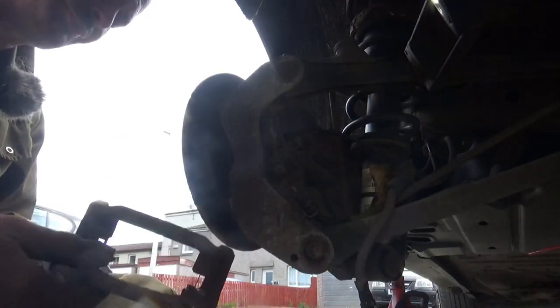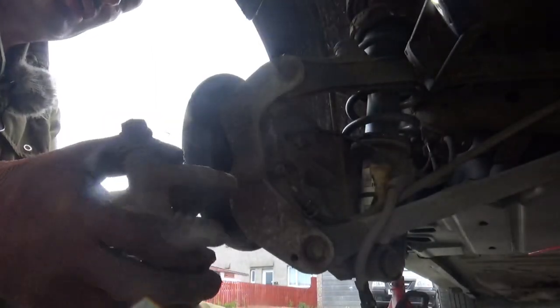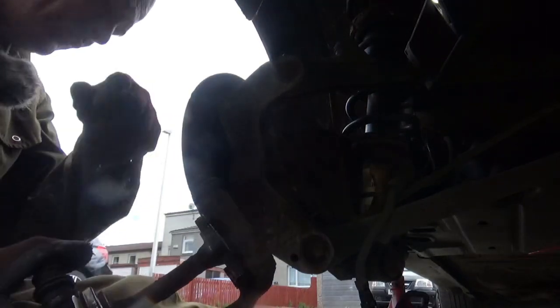I'll put the carrier off. I'm going to give this a clean up with a wire brush, just to get all the rust and dirt off it, and that'll make it nice and clean for putting back on. It's also a good idea to renew your brake fitting kit here. Unfortunately I don't have a spare brake fitting kit - I thought I did have a set on the spares - so I'm going to be reusing these. These are stainless steel anyway, so they're in pretty good condition, so I'll get away with cleaning them up and reusing them.